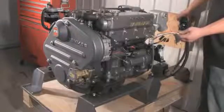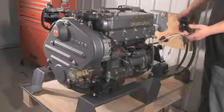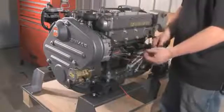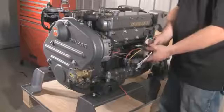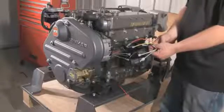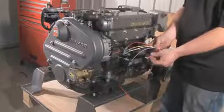It needs to be installed somewhere close to the engine, preferably in a spot where you can see the four LED lights. The harness from the SMR-12 is wired directly to the alternator plug. The purple wire in the harness is ignition — make sure that this gets attached to your existing ignition wire.